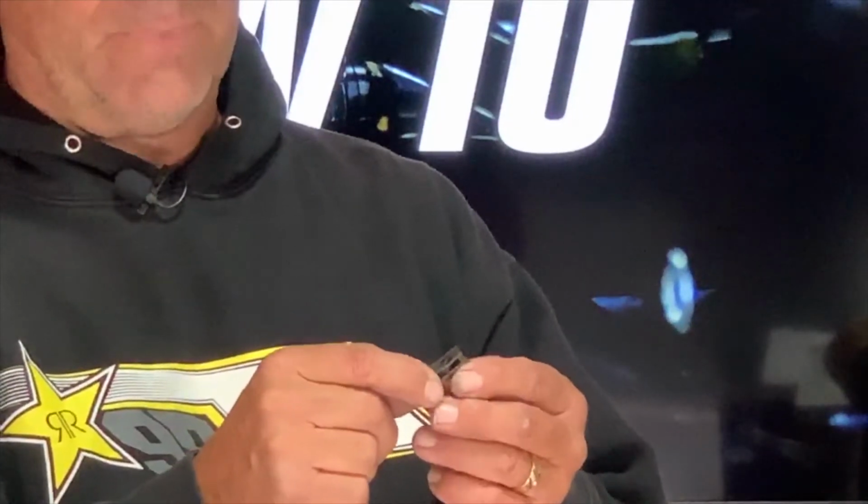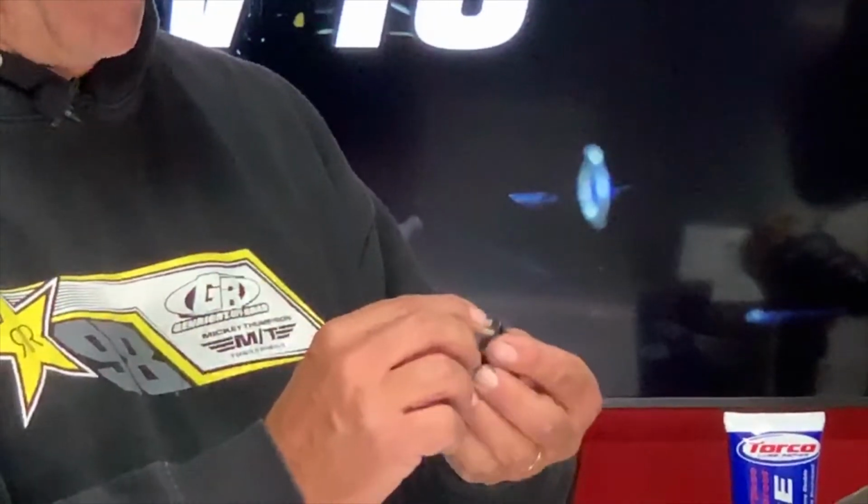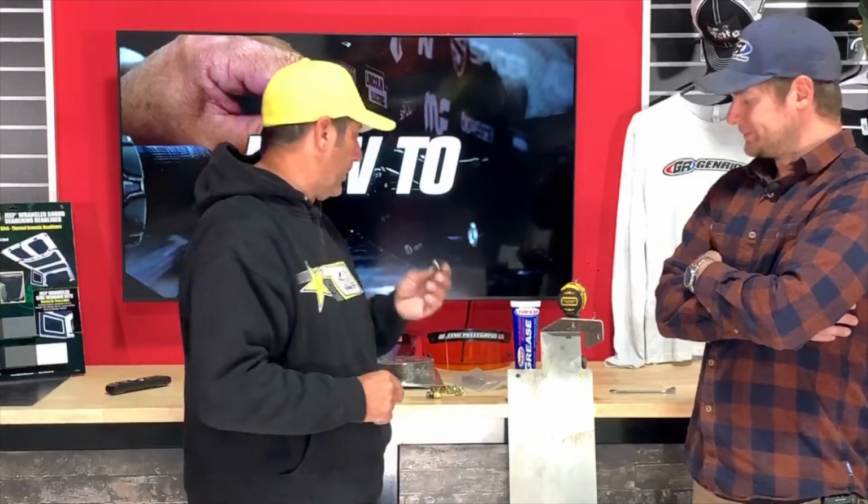The other thing I wanted to show you was there's another type of nut, and this is called a clip nut. We use a lot of these, everything from the rocker guards on a JK or JL to the tabs that hold on an aluminum roof. These just snap on, but there's something about this material that I noticed when I was installing some, that when you go to thread in the stainless steel bolts that we provide, if they're just not perfectly lined up, they'll start to gall. So I'll give you guys a tip: once I've got them all in and everything's lined up, I'll take a 1/4-20 tap with a little grease on it and run it through. It lines everything up perfectly, and then with a little grease on your bolts, put them right in, and they won't gall or strip, because you've got a small Allen on the top of this and you don't want to mess that up. So just a quick little tip on that.